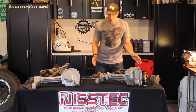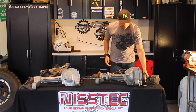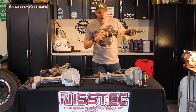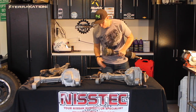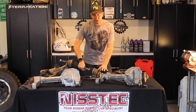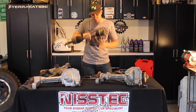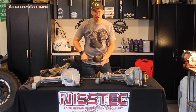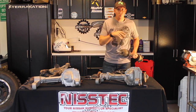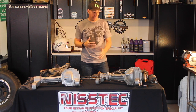The difference between the R180 and the M205 is that it's a bolt-on half shaft — these hubs right here bolt on to the half shaft, and that's what goes to your wheel. So if you break a CV joint somewhere in here, you can bolt it off, pull it out, slide a new one in, bolt it on. It's a pretty easy trail fix, which is one more reason why it's a little bit better, on top of the extra strength.